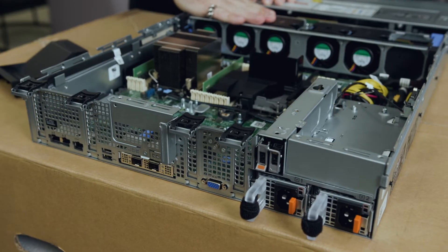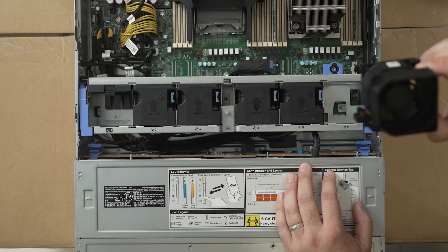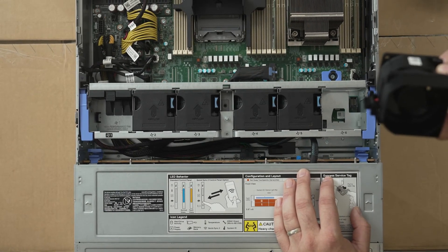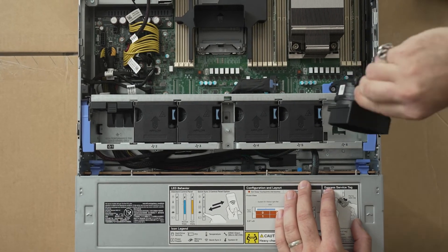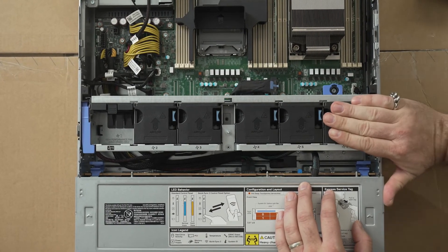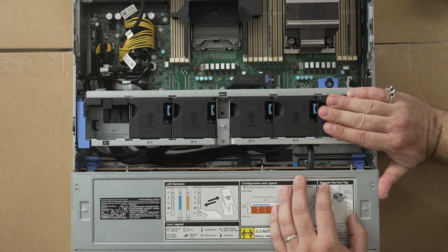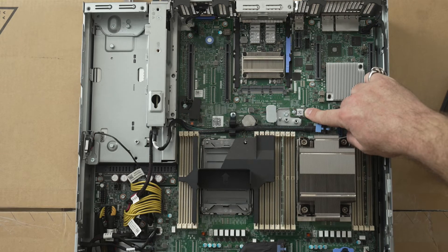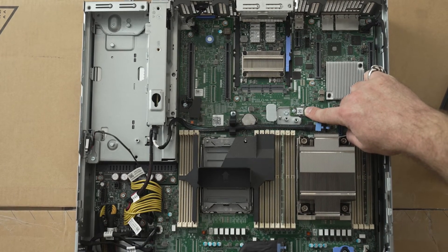You've got new design fans. These are bigger than the 14th generation fans — I believe the old ones had three blades, whereas these are now five-bladed fans and the actual unit is a lot bigger than the old models. There's been a very big emphasis on redesigning how the server is cooled. We also have the TPM 2.0 module, because everything needs a trusted platform module now.